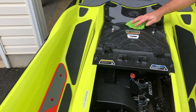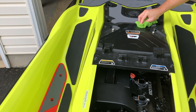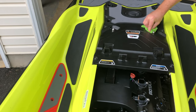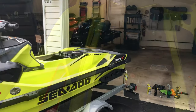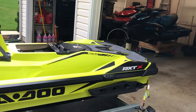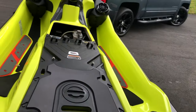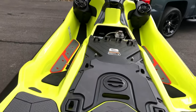We're going to get this a little bit of cleanup with Ultimate Black — this is really good for all the plastics on the jet ski. It'll give it that factory finish so when we go to use this next year it looks brand new. This jet ski is winterized and ready for next year — batteries disconnected, engine is fogged, cooling system is completely dry. Please subscribe and stay tuned for more how-to videos on how to winterize a Sea-Doo jet ski.